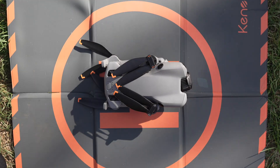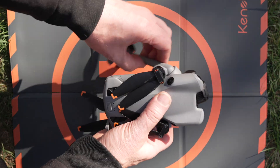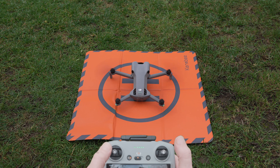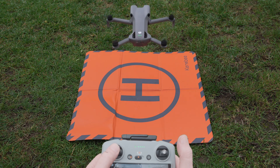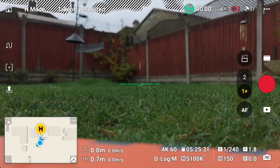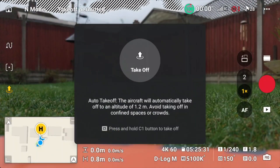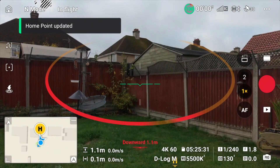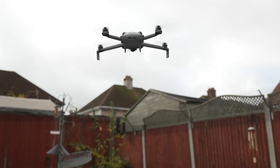Place the drone on a flat surface — a cheap landing pad is a great investment to keep grass and dirt out of your camera, gimbal, and props. With the drone and controller connected and all pre-flight checks done, it's time to fly. There are two ways to get airborne: you can pull both control sticks down and inwards to start the motors, then gently push the left stick up. But for your first time, I strongly recommend the easy button — on the left of your screen, tap the takeoff icon and press and hold the circle that pops up. The drone's motors will spin up and you'll gracefully lift off and hover about four feet in the air. And there it is — you're flying.